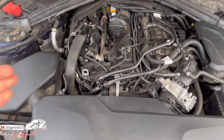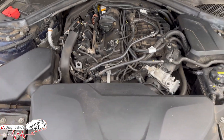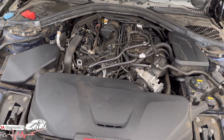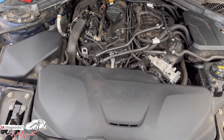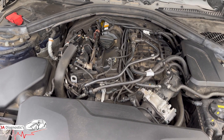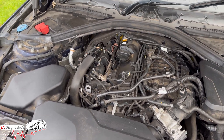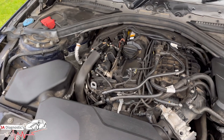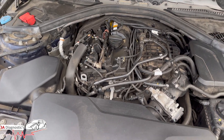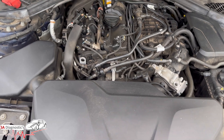What you'll need to do is check the wire going into it, make sure there's power going to it. If there is, then you move on to the next step and order a wastegate. The wastegate is probably a bit difficult to find, but do your best getting an OEM one. Sometimes it's very hard to find just the wastegate on its own — there are only complete sets such as the turbo and wastegate sold together. But I would recommend just getting the wastegate and testing it that way, as it'll cost you a lot less.